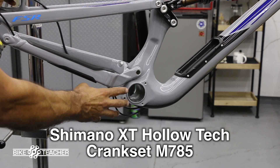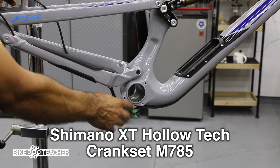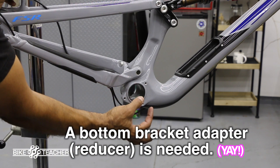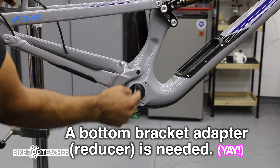With this system right here, I'm going to go ahead and install a Shimano Hollowtech system. The spindle running through there is only 24 millimeters. This opening right here is about 46 millimeters in size, so our new bottom bracket needs to press in here and then be reduced down so it hugs that 24 millimeter spindle.